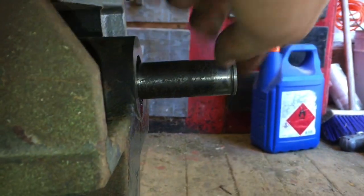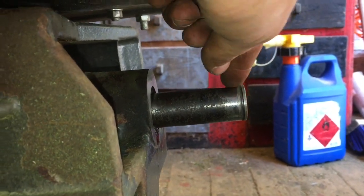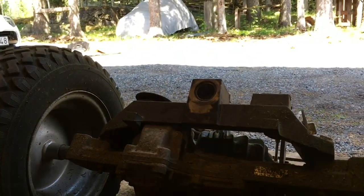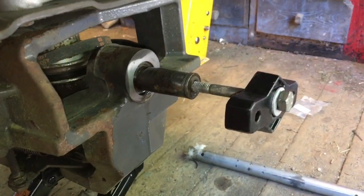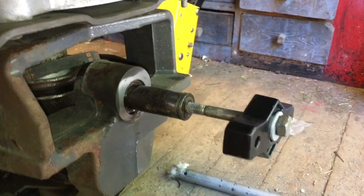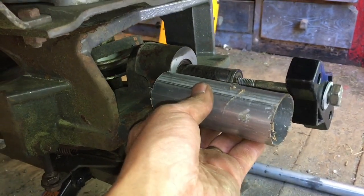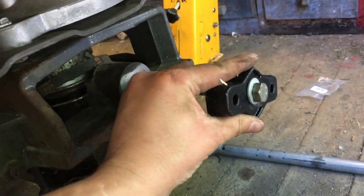So now I just have to remove the axle, and you can actually see how worn it is here. I couldn't just have changed the bushings. But if your axle is only a little bit loose, then you can only change the bushings in there and then it will be much easier. So how do we get this axle out? There is a special tool for it, but there are threads in here. I have a long bolt and just cut off a pipe — this is actually a Briggs and Stratton flywheel puller which I bought a couple of years ago.